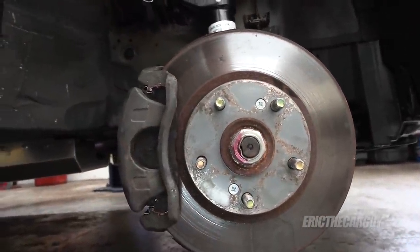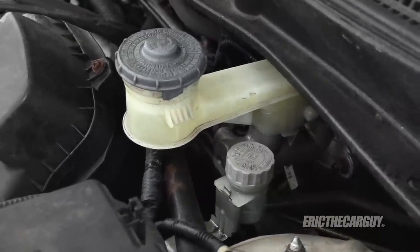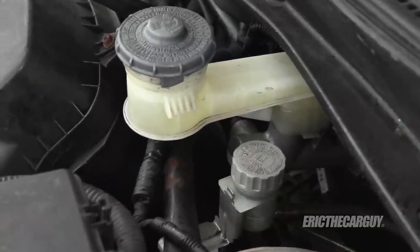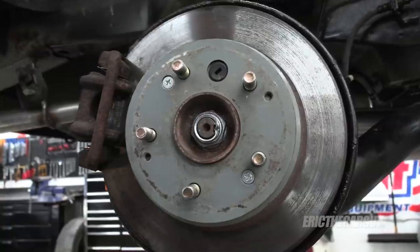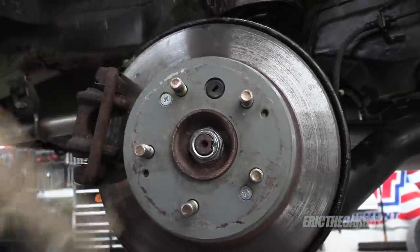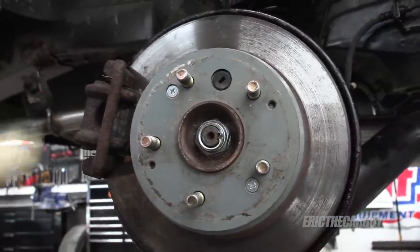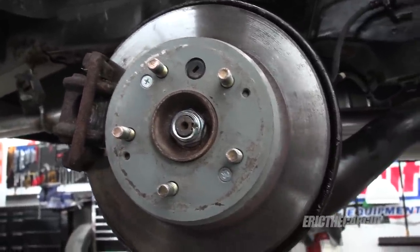Also new rotor screws. Since I was working on the brakes I went ahead and replaced the brake fluid and the clutch fluid — figured as long as I'm here I might as well get it done. I hit the reset button back here, also installed the plug on both sides after adjusting the brakes. Didn't have to drill and tap back here, thankfully.